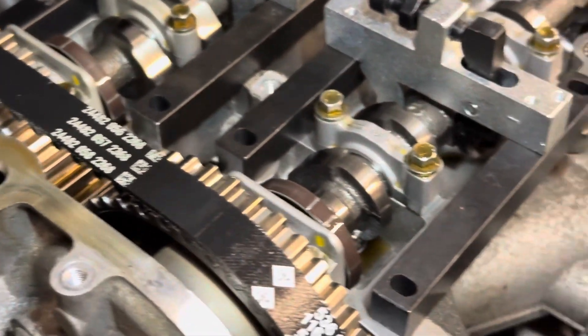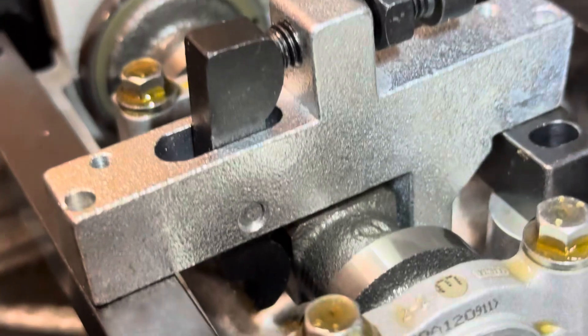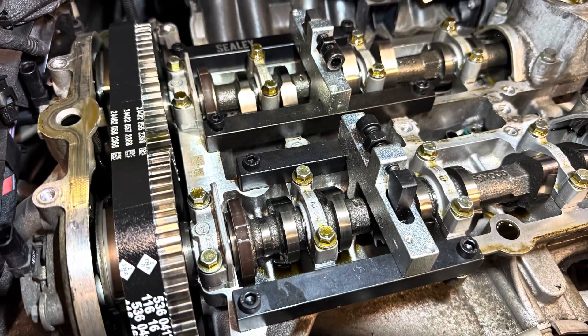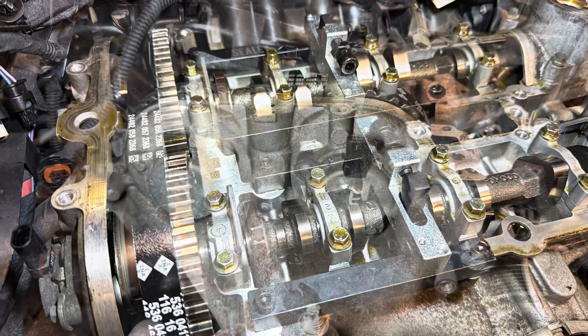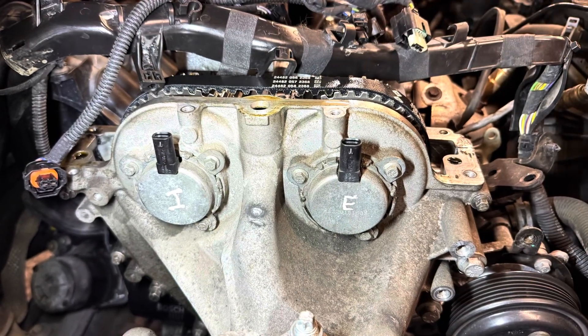I did like using the laser equipment — it is obviously cheaper — but I think this CLA kit is much better. The main difference is being able to adjust and set the VVT timing on the cam pulleys.